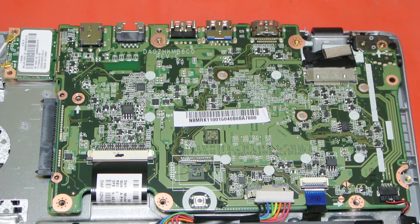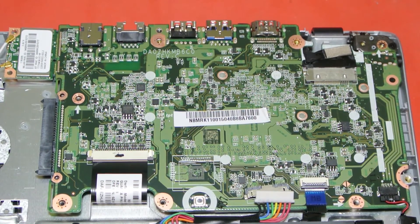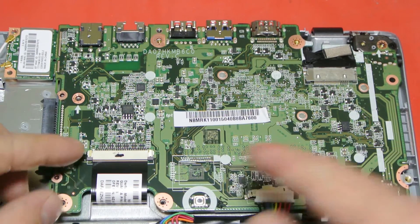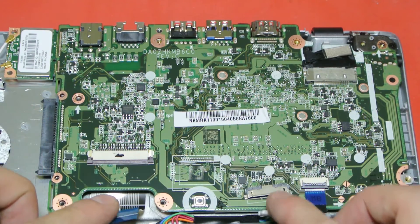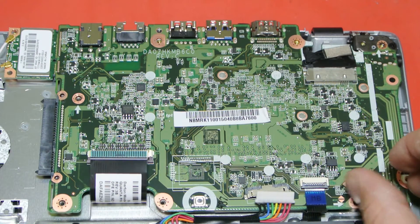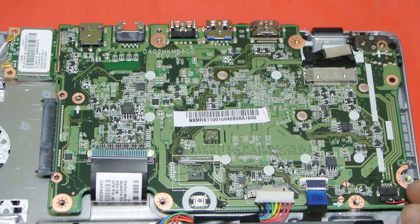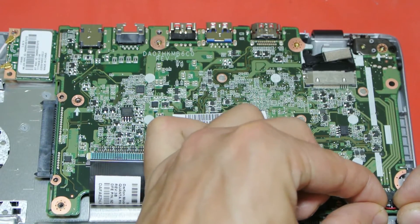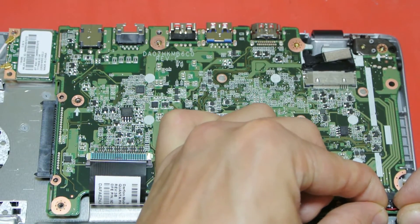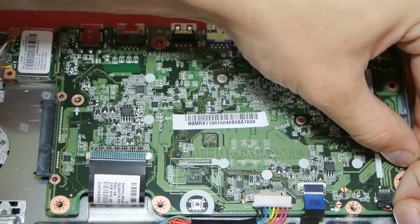Actually there was a sixth screw up here as well. There are four screws at one length and two smaller ones — the two smaller ones are here and here, just for reference. Next, start disconnecting all the ribbon cable tabs to get the board out. First is the keyboard — just pull these two little tabs and that's out. Next is the trackpad — flick that up and remove the tab. Then we have the speakers — go really gently because some are quite stiff.